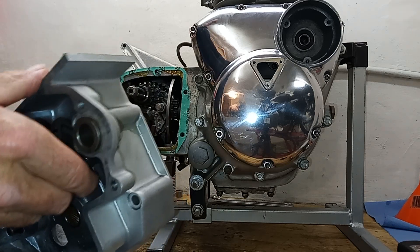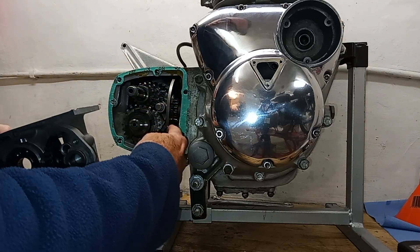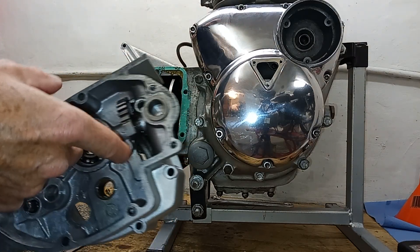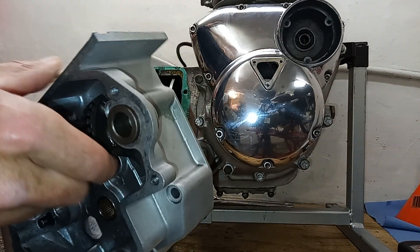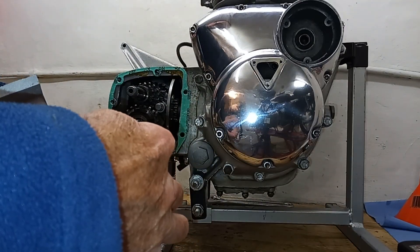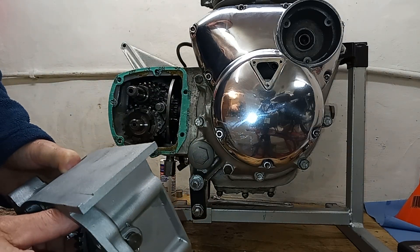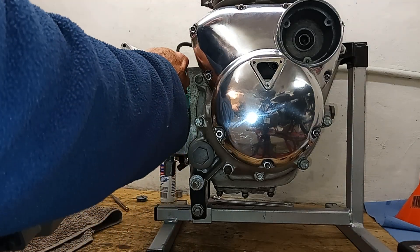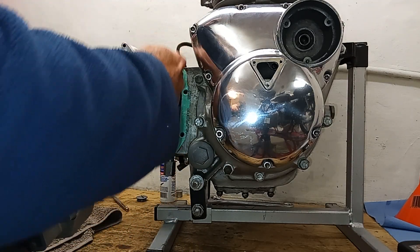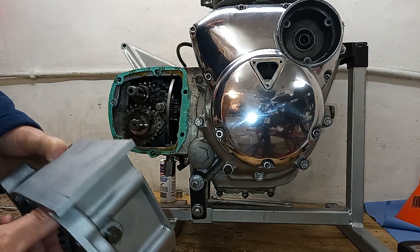Basically this quadrant goes up and down changing gears. What we need to do is, as we have done, we've put the cam plate into first gear and we're going to put the butterfly quadrant up as high as it goes at this end - so it's as low as it can go at that end. That basically means when we're changing gears, this goes up and up and up to change up, because we're in lowest gear, and then we go back down to first.